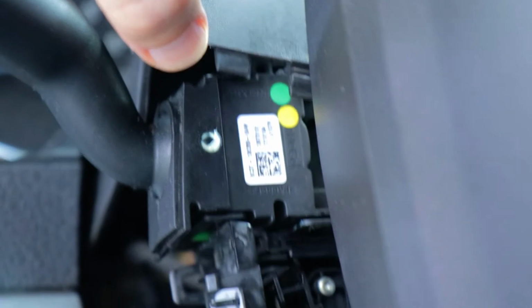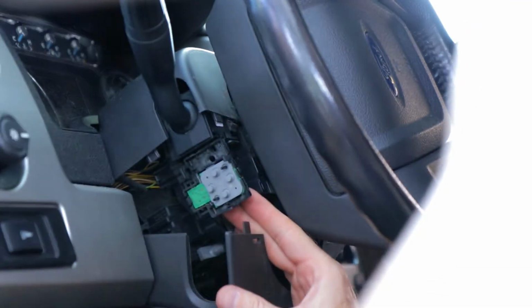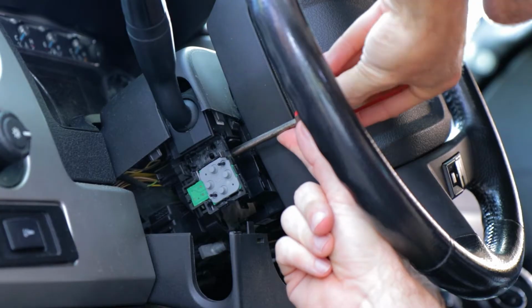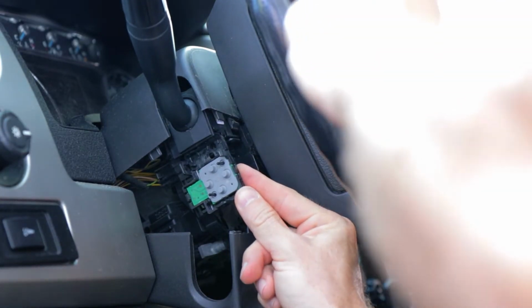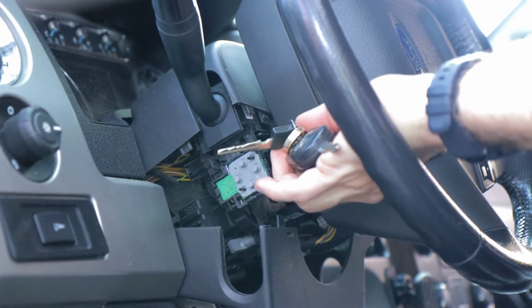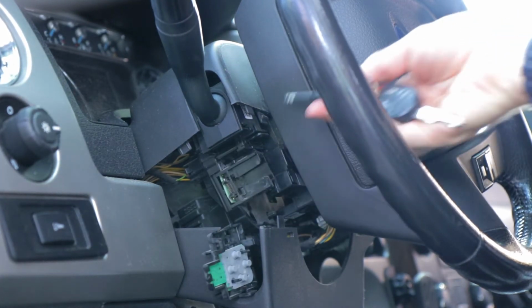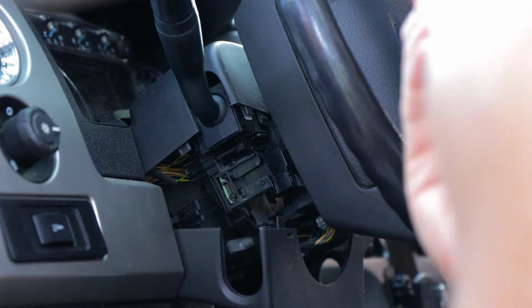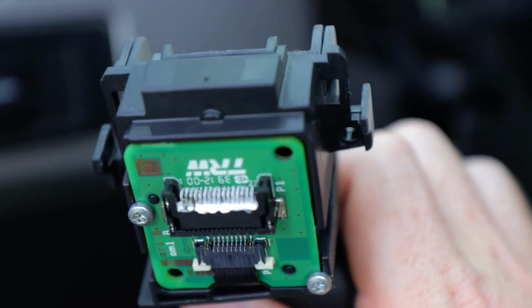I ended up having a little bit of trouble using what I thought would be easy with the screwdriver, so I ended up using a set of my keys that I could fit down along the long edge and just pop up the tabs. Next thing was actually removing the switch, which is what those pink arrows are pointing at. Very small tabs that once you pull it aside, you can just pull the switch right out.